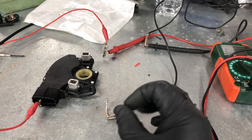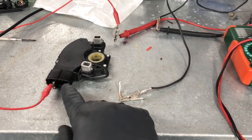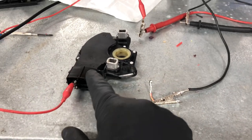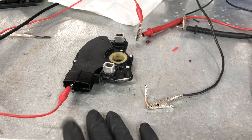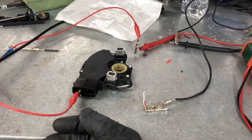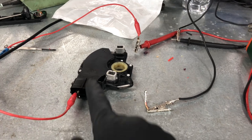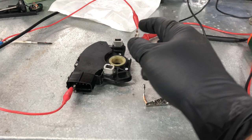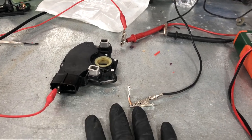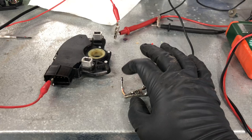Those little intervals where you do not have signal is what's causing my car not to start, and it's so intermittent. This little pin - just the expansion of the metal when it's hot out and the contraction when it's cold - is enough to lose connection inside of this plug and cause that car not to start. Ford actually sells a pigtail assembly to replace the plug end. I've only got about this much room to work with under the car, so I just don't have enough room to pull that harness all the way down and replace each individual wire. I know my other wires are working because I'm getting signal to this and getting signal out of it in other gears. It's only this park and neutral situation - the wire the power goes through - that's caused me an issue.